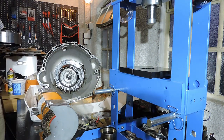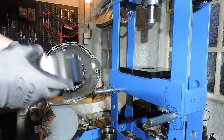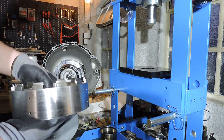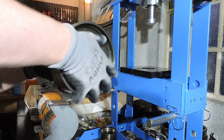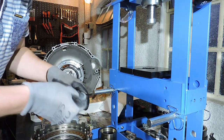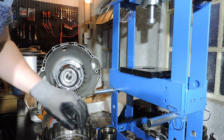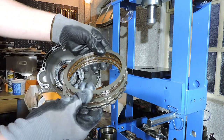All right. We are nearing the end. I've still got the big drum that is being held by the brake band with a needle bearing right here. And after I actually put in this drum, we're already going to put in the pump with the C1 clutch and the sprag bearing. So first, as before, we're just going to work on this clutch. Let me just get that bearing out just to make sure I'm not going to misplace the bearing. There's the snap ring. Now let's remove the pack. Hang on. Got some pieces who want to stay behind. Here's the pack. Thick end plate.